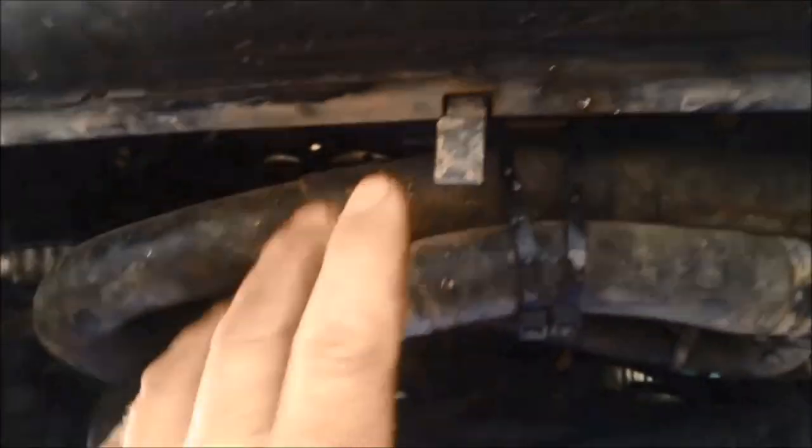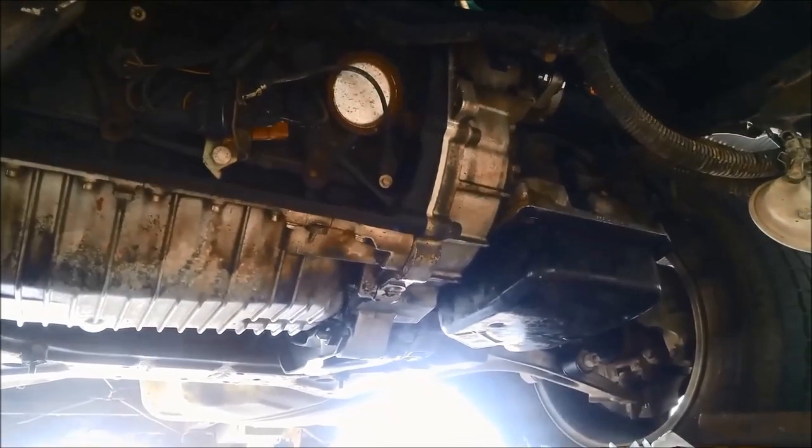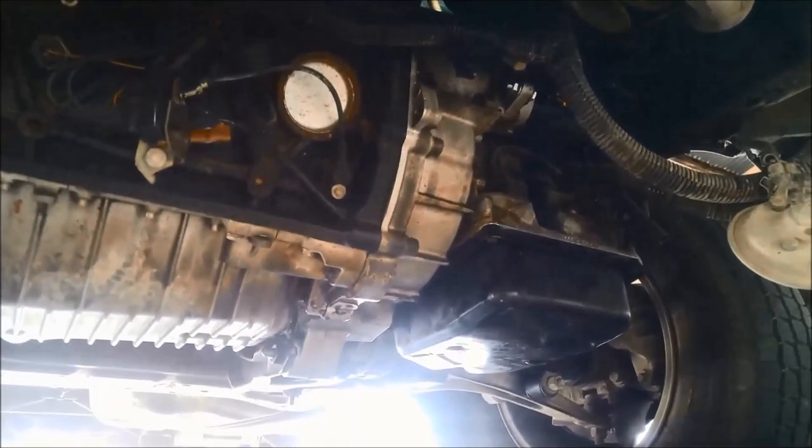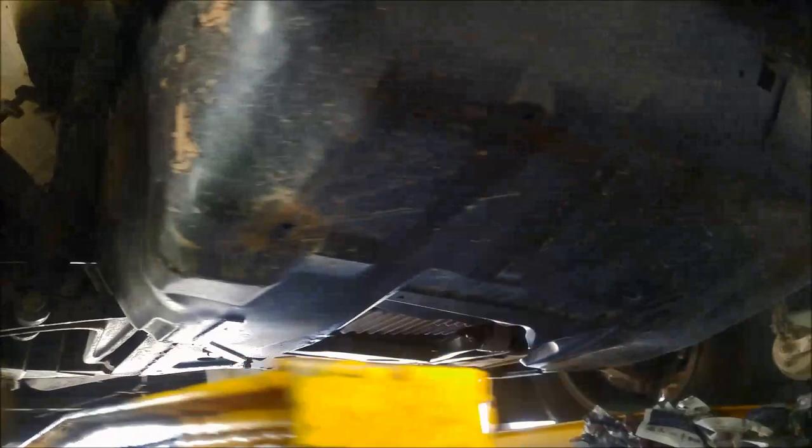Just got to put the cover back on. Remember when you're putting it in, hook it in here and then hook it over this little plate there just until it holds, and then you can have it up. Finally, the oil level — when you're testing it, it's got to be between 35 and 45 degrees. If it's at 50 degrees or over 45 degrees you've got to let it cool down and then just recheck it. You poke these in through here, come around the front, click that in like that, and that just holds it up until you get the bolts up. Thank you for watching.